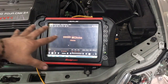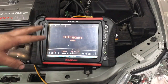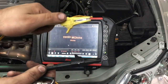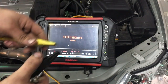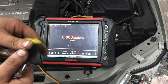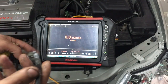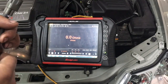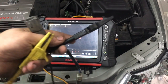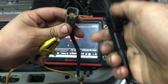I've got my Snap-on meter here so you can see the screen. Right now we are on ohms and we're at infinity, meaning no current is passing through. If we hook these up together we'll basically have a bridge. To test if the heater circuit is still working, we should at least get a reading, so I'm gonna hook these alligator clips to the two black wires.